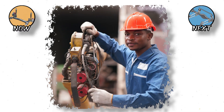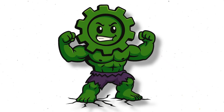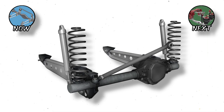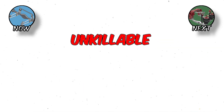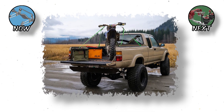Engineers can spend the saved money on better interiors or safety features. But when you need something that can take a beating on gravel, dirt, and rocks, you'll need something beefier. Solid Axle: The Tough Guy. The solid rear axle, also called a live axle, is pure old-school muscle. Both wheels are locked together on a single solid beam. It's unkillable, easy to service, and perfect for putting power to the ground. Off-road trucks love it because it's durable and simple — fewer parts to break in the wilderness.